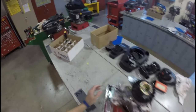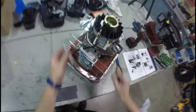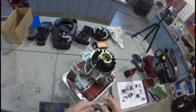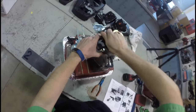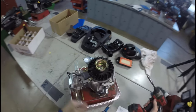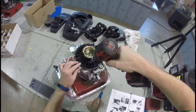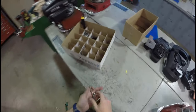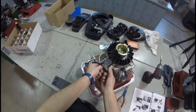Removing the ignition module — which is this piece right here. Notice that these look very similar but they are not. You can see that this piece is a bit higher and there is a different color here too, probably a different material overall. I'm going to do this by hand to begin with, just because I don't want to damage this ignition module. These have a specific clearance between the flywheel that it has to have in order to actually ignite the spark plug. They do that before they send it out to the shops for sale. After this is out it will be stuck to this magnet. I'll put these over here. This is the kill switch, which I'll get into at a later date.